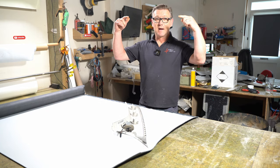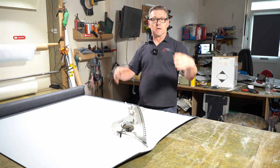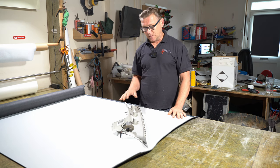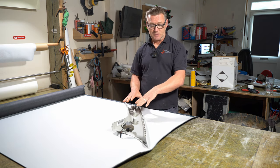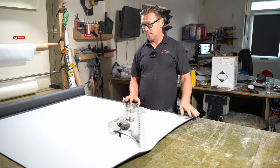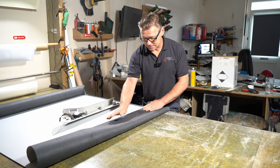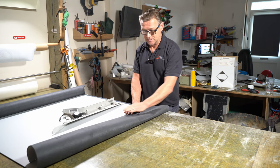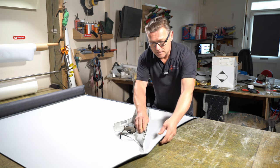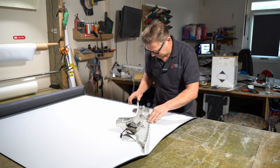So it runs from the top of the headlining down to the bottom of the dash at, I wouldn't say 45 degree angle, but it's not far off. So having this run this way is perfect anyway for the direction of the fabric. Because it is a fake suede, it has a definite nap to it. So you have to get that right. What I'm going to do is lay it onto the fabric and then just check, make sure I've got enough, plenty there.